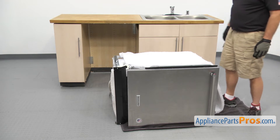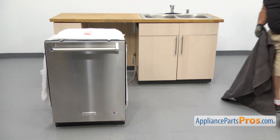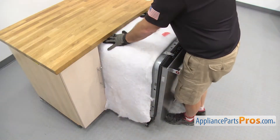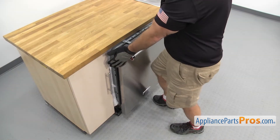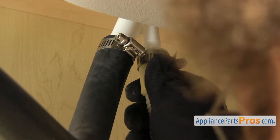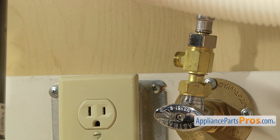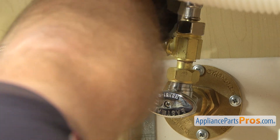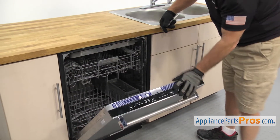Once you have the drain pump installed, we can lift the dishwasher back up on its feet and take the towel out. Now we have to reach underneath and put the lines through the cabinets. We want to push the dishwasher in about halfway, then go underneath the sink and pull on the lines to make sure they're not caught on anything. Then push the dishwasher in the rest of the way. Now we can reconnect the drain hose to the air gap. Once you have it pushed up into place, use our 5/16 inch nut driver to tighten down the clamp. Once the drain line is hooked up, we can hook up the water line — get it started by hand, then use our 5/8 inch wrench to tighten it down so it doesn't leak. Now that we have the lines reconnected, open up the dishwasher door and use the Phillips screwdriver to put in the screws to hold the dishwasher to the countertop.